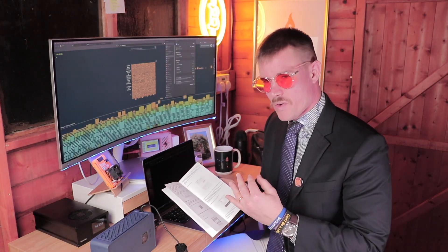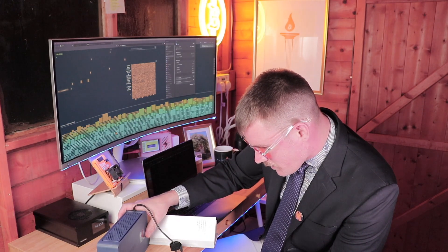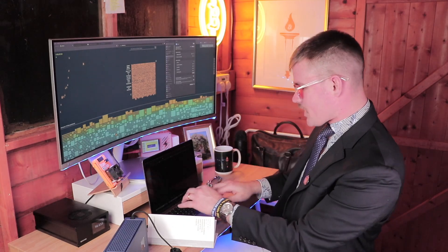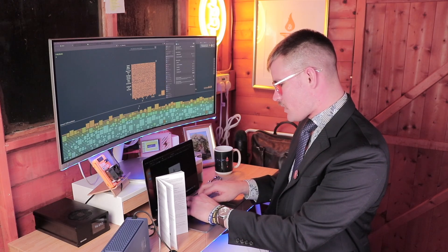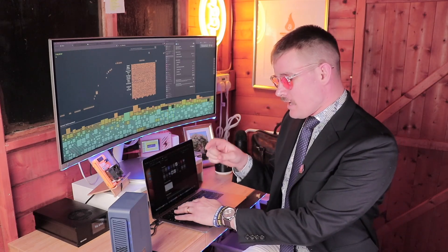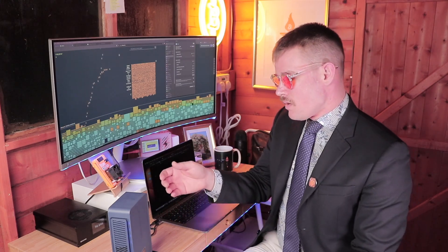They provide an app where you can set the Nano up, but I'm curious if I can just do it on my computer without downloading an app. It's giving me an IP address right here, so I'm going to hit that IP and see if it gives me admin control. I see it's already hashing — I assume to their pool, not mine, so that's not great. Similar to a Bitmain product, the username and password is root lowercase. This is how I can connect it to my Wi-Fi. The machine is now connected and gave me a new IP address, which I assume was assigned once it connected to the Wi-Fi, so I'll go there to input my pool settings.